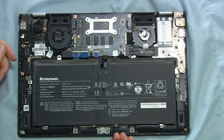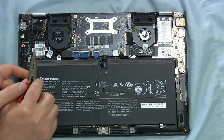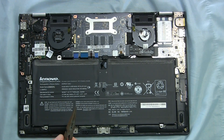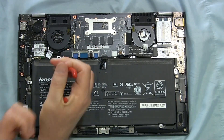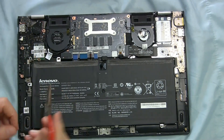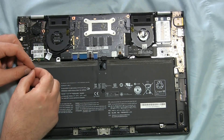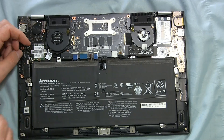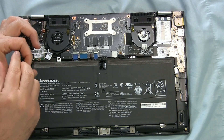We've got two what they call wireless LAN cables — I assume they're the antenna leads, black and white right here. One screw, some tape holding it down on both sides, and here at this end is where it actually slides into the slot and the little metal contacts make connection. They tell you to start by removing the black and white cables — I'm thinking it's just a matter of pulling them straight back. Everything is super tiny and miniature though. It's actually more like a snap, kind of like a nine-volt battery, that little cap that snaps over the top. I did not expect that — so it's just a matter of pulling it up gently and the cover will pop off the top of it.